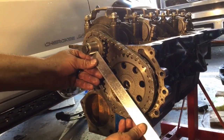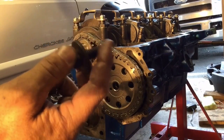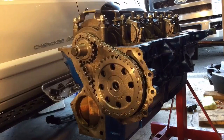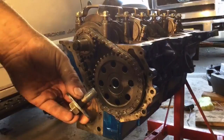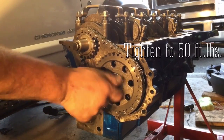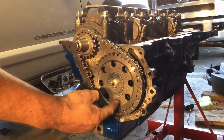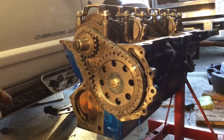We want these marks perfectly lined up from the crank, straight through the marks, straight through the cam. This is the cam gear bolt that would be used with a factory camshaft if you were using the retaining plate. Since we're not, this is the different thread pitch bolt with a spring-loaded pin on it that I got from 505. Per the instructions from Comp Cams, thread Loctite on the cam bolt — a healthy amount. Let's drop the pin and spring out for now, put that sucker in, and we're going to torque this down to 50. You shouldn't have an issue of that cam gear spinning. If you do, you can run a punch or an Allen wrench through that galley plug just to hold it in place. Then put the spring and pin back in, and install the oil slinger.